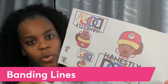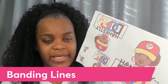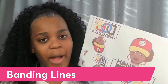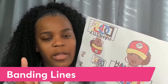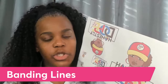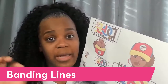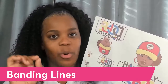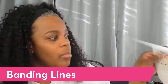And this is whenever you are using plain paper setting set to standard on a Windows PC or normal on a Mac. This is from plain paper, bright white or high quality plain paper, but the quality is set to standard or normal. High quality does not mean you're getting high quality if the quality setting is on standard or normal. You have to increase that to high or more settings.